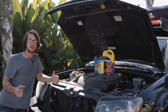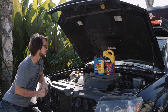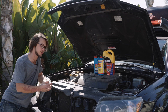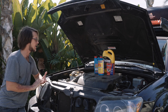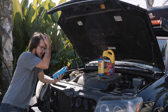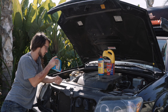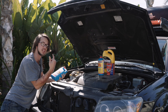I'm actually pretty hopeful — I could end up being a good review or a bad review for this product, but we're going to give it a shot. So here's the game plan: we're going to drain all the coolant that's in here now. I don't know how much you need this — depends on how dirty your system is. Mine's not very dirty, but I'm playing it safe. I got this radiator flush. We're going to fill it all back up, run this through, and we're taking out the thermostat so everything can just flow.